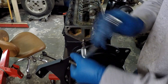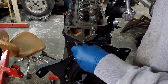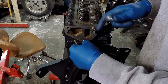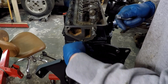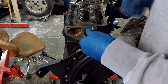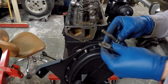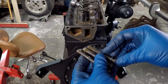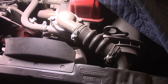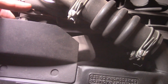Essentially what I ended up doing was putting the bolts in and then measuring the clearance — trying to bottom them out. These are blind holes here, so I tried to bottom them out and then measure the distance between the surface of the water pump machining and the bottom of the head bolt. I'll show you here real quick the difference in the lengths of the three bolts — you can see here the difference pretty clearly. My original video on this discussed which bolts go into which spots for the water pump housing.